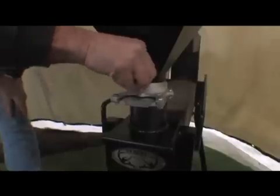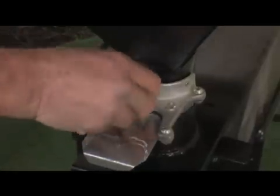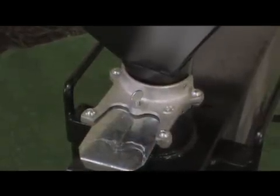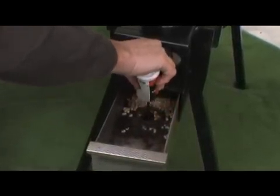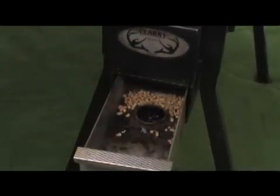Now open the shutoff gate, allowing the pellets to drop into position in the firebox. By the way, you'll want to tighten the set screw in the shutoff gate so you don't misplace it. Next, you'll open the ash drawer. A few pellets will have fallen through the fire grate. That's okay. Squeeze a liberal amount of liquid gel fire starter into the drawer, aiming at the bullseye.